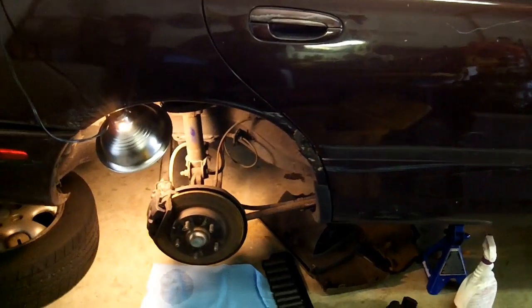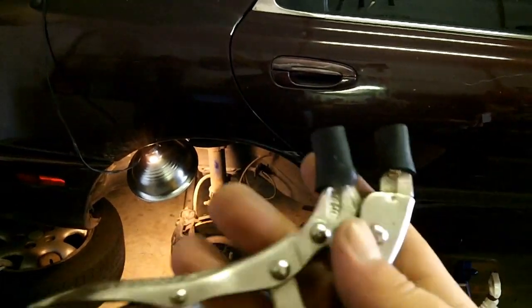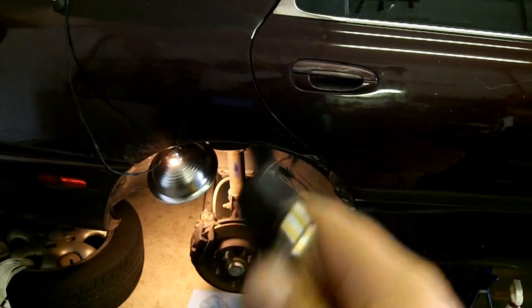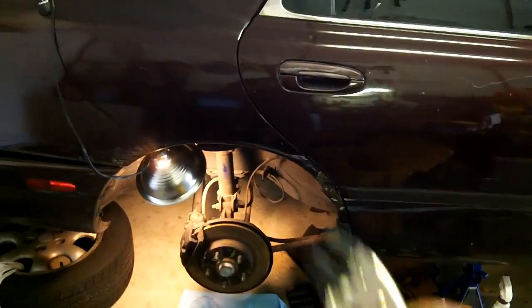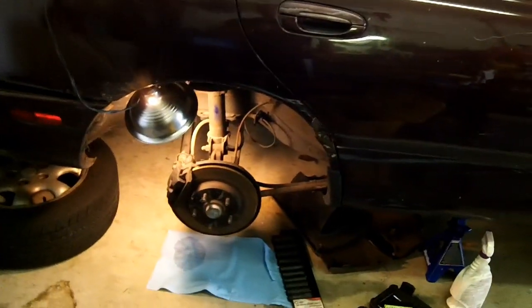1996 V6 ES Mazda 626. This has rear discs on both the rear and the front. Picked up a tip from Eric the Car Guy — mine aren't as nice as his, but put some rubber hose over your vice grips and clamp down on the brake hose. Hopefully you won't break it; that should pinch it off and there should only be a minimal amount of brake fluid loss.